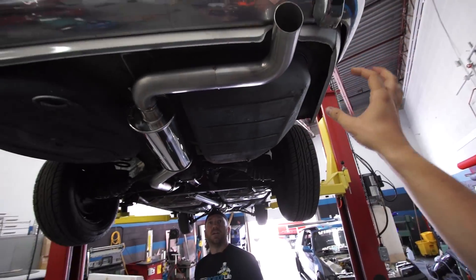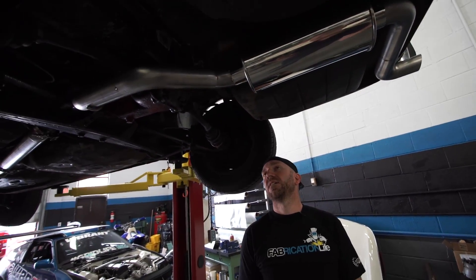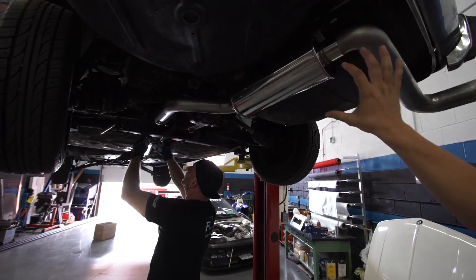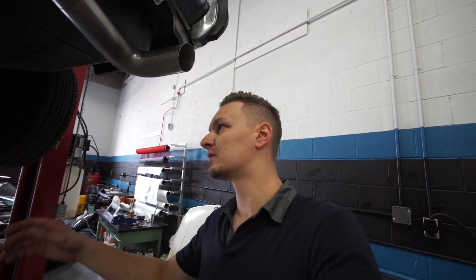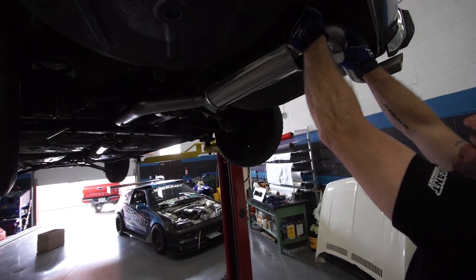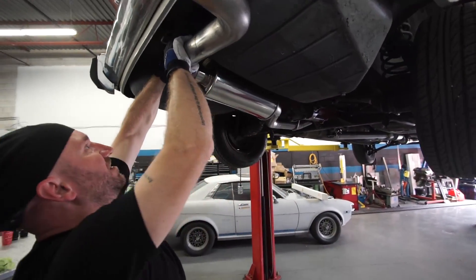This is the factory setup of how it was - it's just now it's two and a half inch instead of one and three quarter. So the factory muffler body actually sits here. We used the universal six inch Vibrant Performance muffler in place of where the factory body normally goes. And this one's stainless steel - won't rust like the old one did, which had tons of holes that made extra noises. Looks much better now, much cleaner, and still retains the factory shape but just beefier.